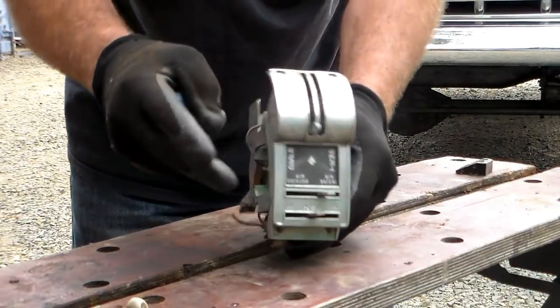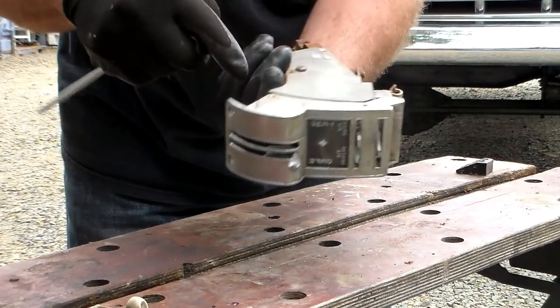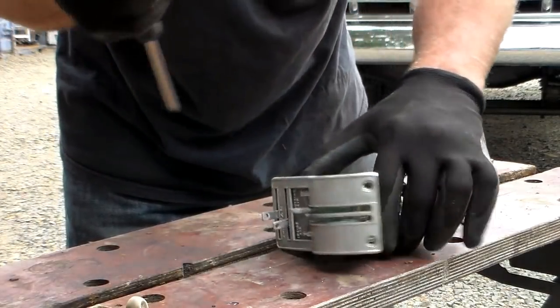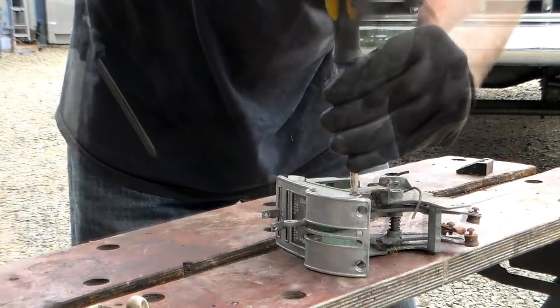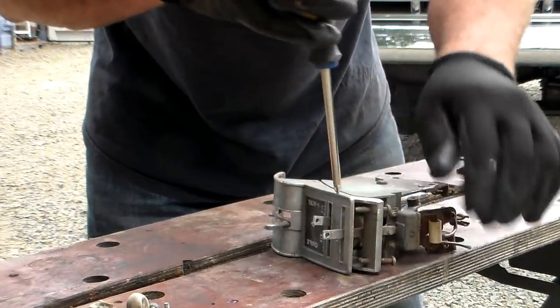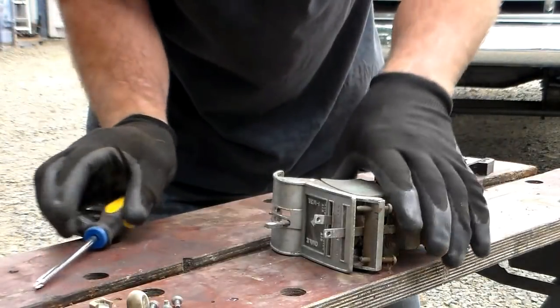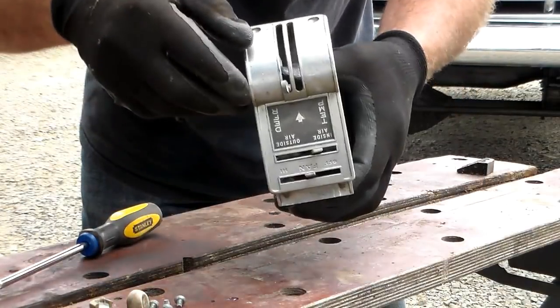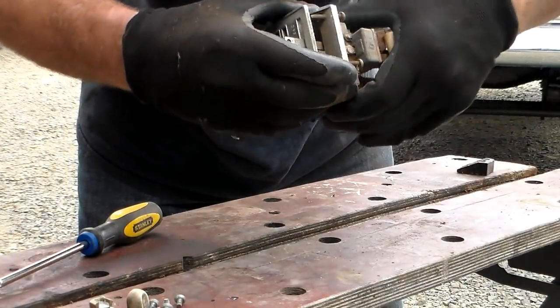And then the next thing that I remove after I get the knobs off is the faceplate, and that's held on by 4 screws on the side. And you gently pull the face off. Just wiggle it a little bit. You want to be careful.